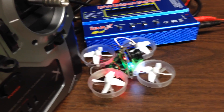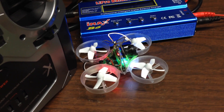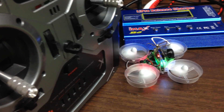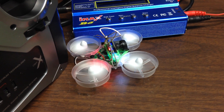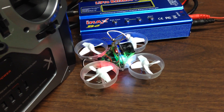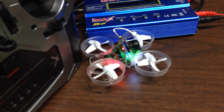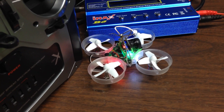I'm just going to show you — I usually lay this on a short rug upstairs and run three packs, and I like running four if not five through it. Just bump up your throttle a little bit. I'll let it run. You might shut it off, let it cool off a little bit. It's just real important you break these motors in before you start ripping around on it, or they are not going to last or perform near as good.